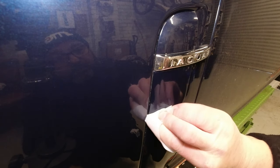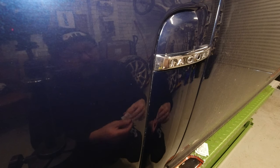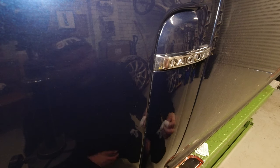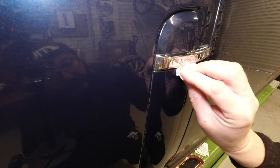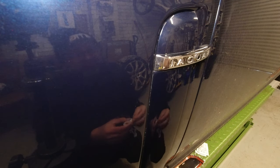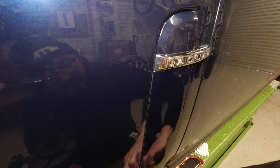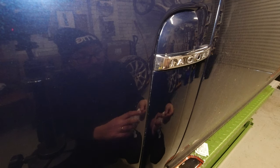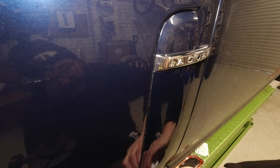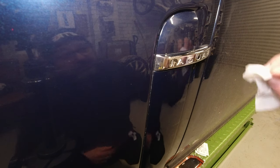Right, it's a good tip when using wipes like this, whether they're alcohol cleaners or adhesion promoters, try to use them sweeping in a constant direction, in a constant pattern. It might seem completely excessive, which if you see my videos, you know I don't have a problem with. But what it does mean is, if there's anything on the surface, you're not scrubbing it round and over to one side, then back. You're hopefully taking it away or moving it all to one point. So I'm following a standard pattern, and each time I'm just folding the tissue a little, so I go a different surface.